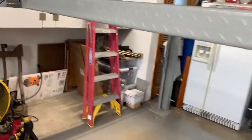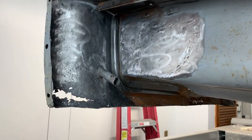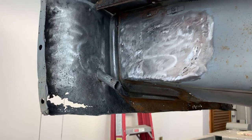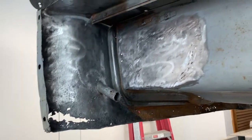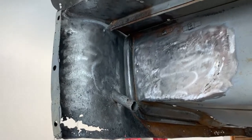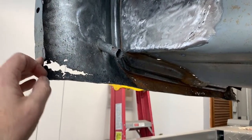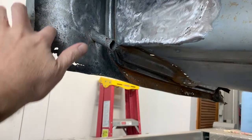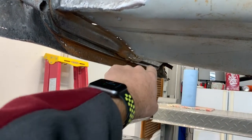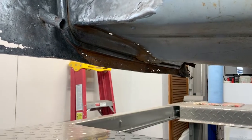Up here things are progressing — I got it all mostly cleaned out. I've been test fitting a few of these pieces in here and that all fits pretty well. Once I've got all my joints done, I may tack weld them, or I may just make sure they fit and leave them for now. The next thing I'll need to do is come in here and work on these repair pieces — they're all quite perforated and thin, so I'll want to repair at least all the way down to here and then across the back. I've started shaping the cross piece that comes across here, doing it in two pieces — one from the middle backwards, then the other side.